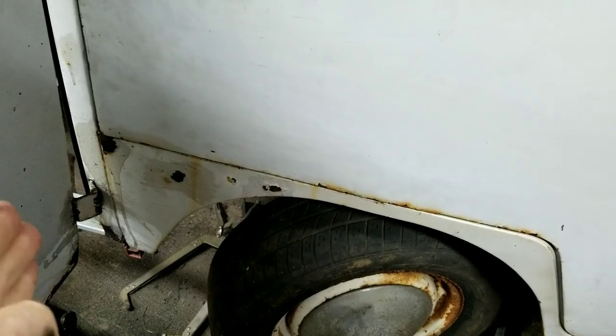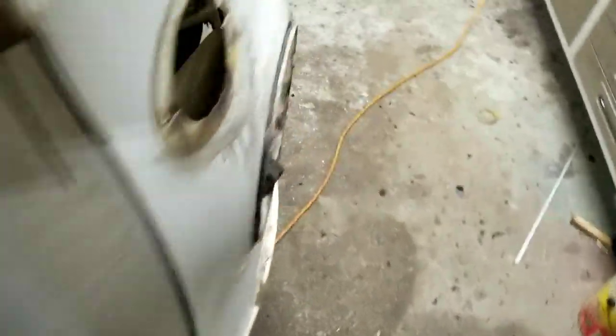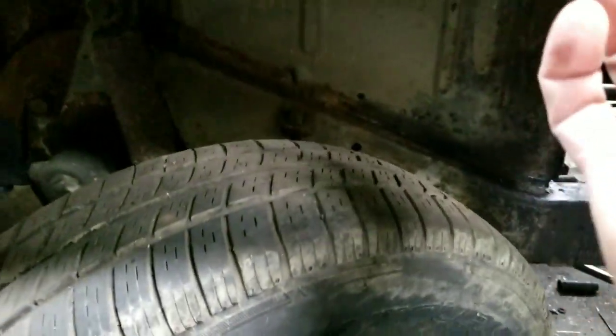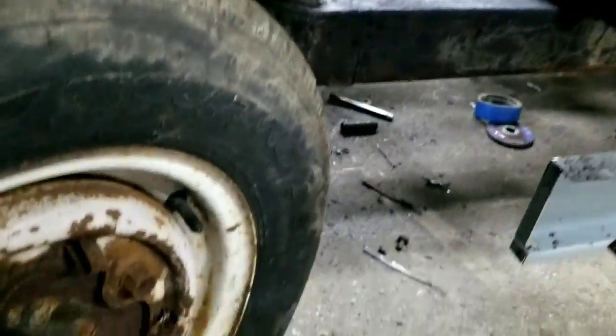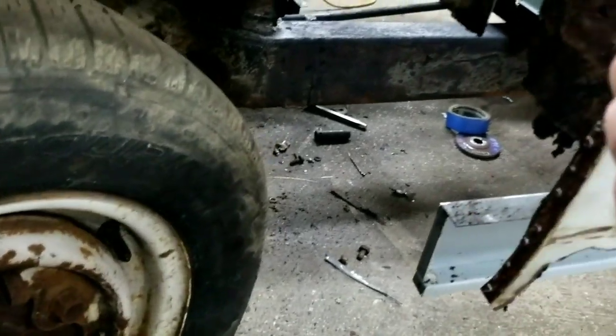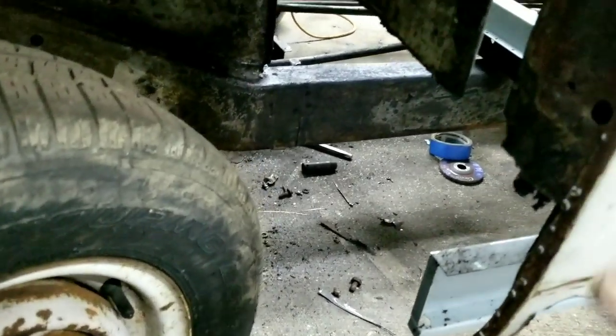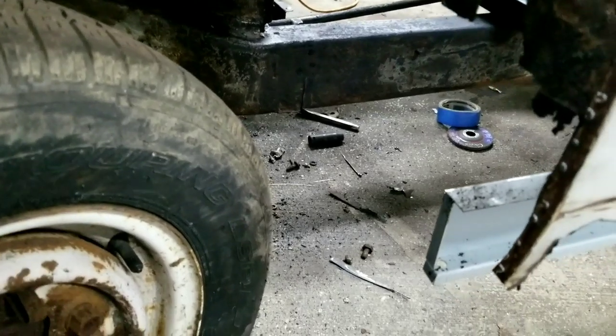In order to finish up the front cargo floor I had to pull the dog legs off, because otherwise I weld that in and then I might have more work to get this out with more spot welds on there. Really all you need to do is cut right up under here as close as you can - I use my little saw, you could use a cutoff wheel. Then like a can of spam, a lot of people will drill all those spot welds but that just takes forever. I just take pliers and roll it up until it comes off.